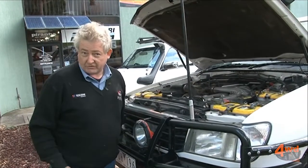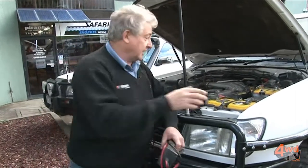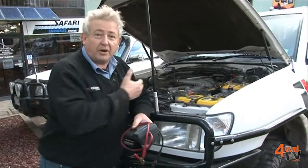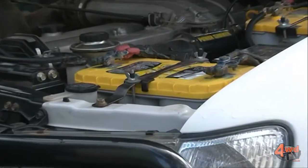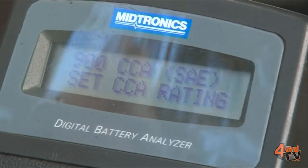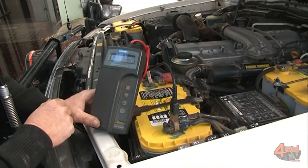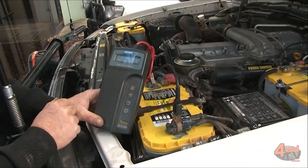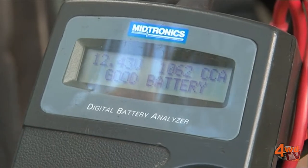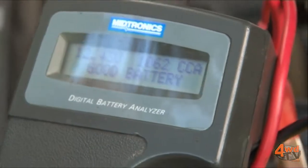The first thing I would always check is my batteries, because obviously batteries going flat can be quite disastrous. Interestingly, these batteries can't be checked in the conventional way — we can't dip them with a hydrometer because they're completely sealed. So the only way we can look inside these batteries is with a plate density tester, which is this machine here. We hit the green button to test and it tells us the battery has 1062 CCA and is sitting at 12.43 volts. The battery is a good battery, but 12.43 volts tells me it needs charging — it has probably been pretty reliable to take on the trip.